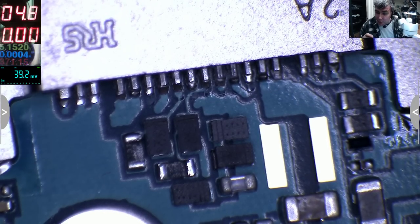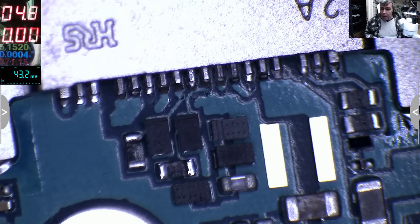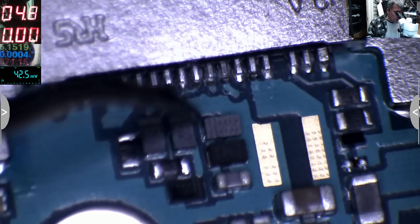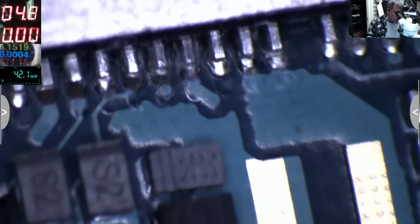Actually, yeah, the micro USB port is a very good design. The issue is you have one pin for ground and one for plus, and you use that pin to carry around 2 amps. That was the one issue. That's why the charging ports get broken. Obviously when you carry so much power, the pin gets hot and at some point will die. So there were not enough pins. Yeah, I understand, and the communication speed is not like the USB-C, but still, you know.